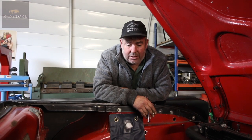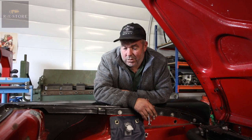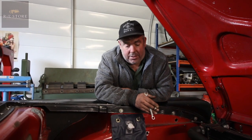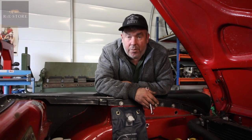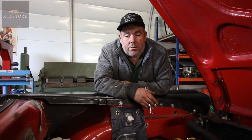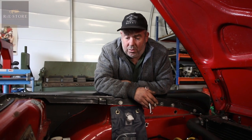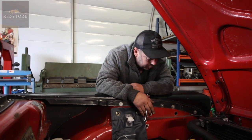What's the drive like? Once it's up and going it's okay - it drives quite smoothly. But it's obviously got a judder when you pull away, which could be brakes stuck on it, could be because the idle's lumpy, could be the clutch. Robbie knows what he's doing - he's had the clutch plate faced off, the flywheel faced off, and a new pressure plate. It's just one of those things - he's going to have to go through it bit by bit and eliminate the problems. Do you think maybe the head gaskets could solve a lot of that? Not the juddering, I don't think, but it will contribute. It's a bit of a weird one. He needs to drive it and see. It's not leaking anymore - it was leaking out of the bottom of the rad. So I'll do the last final little bit, and then he can come and pick it up and drive it and see what he thinks.